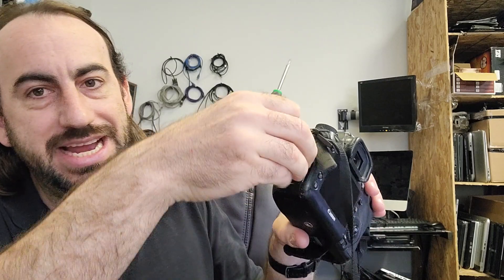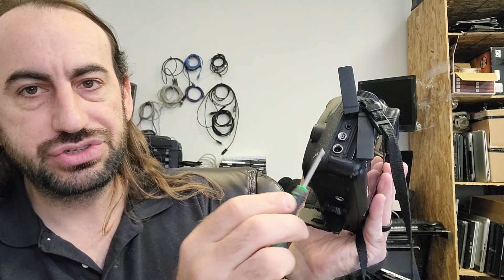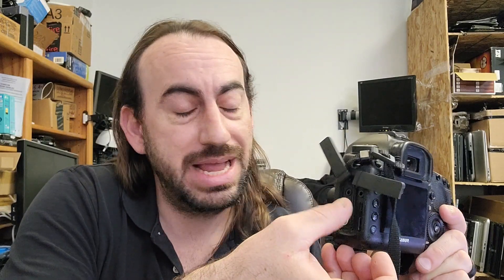And now for step four — the big one. You're going to need a small precision-style screwdriver like you might use for doing your glasses. Open up the side panel right here and you're going to see a little screw. Remove this little screw. This compartment has the CMOS battery — it's similar to what you find in a computer or laptop. This is what helps keep the time, date, and boot settings on computers and on cameras. Remove that and now let your camera sit for at least 30 seconds to a minute.